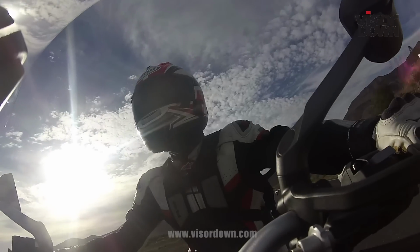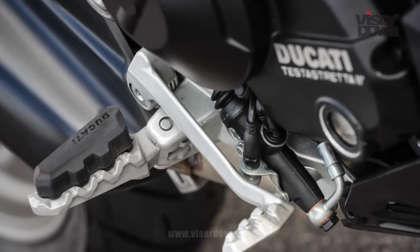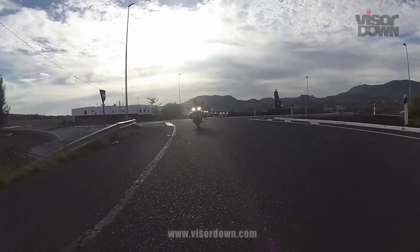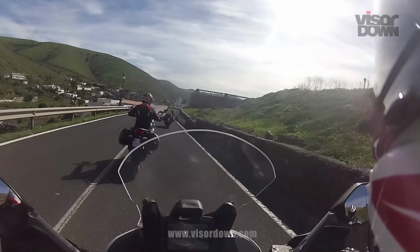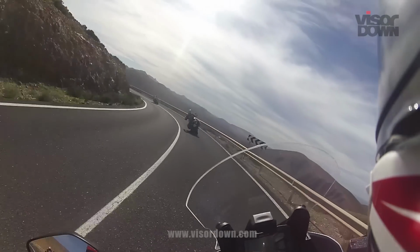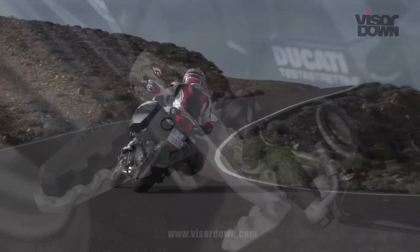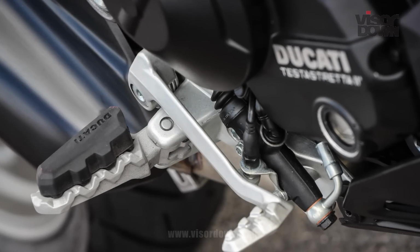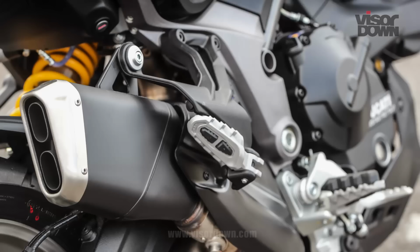One thing that wasn't too stable though was the rubber inserts that sit on top of the Enduro style foot pegs. One of mine fell out within about an hour of riding, and during the course of the day I noticed multiple bikes that either had one or both pieces of rubber missing as a result of them getting worked loose as riders move their feet around on the pegs. As they don't glue in, I think they just don't have a particularly solid fit into the pegs, which isn't great. And while I'm criticising, I thought that the brake and clutch levers looked a bit cheap.